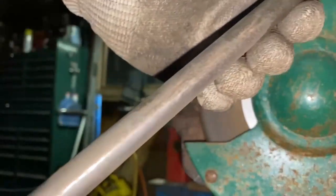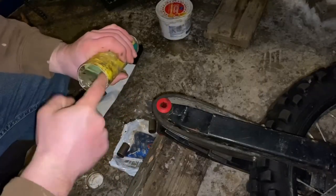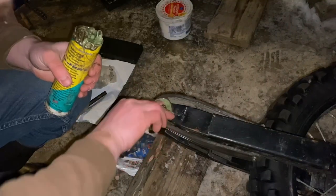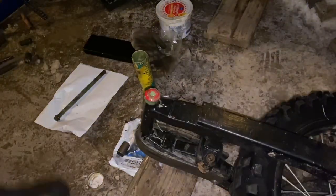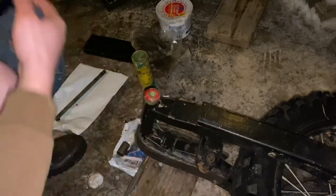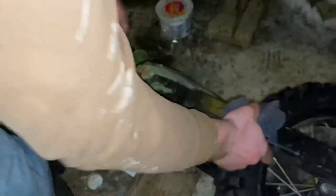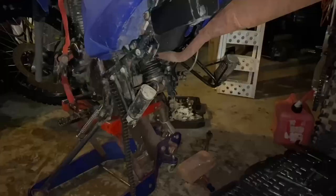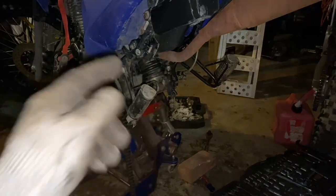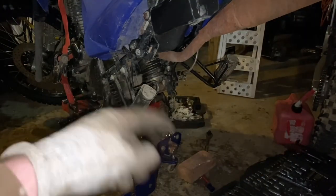So that's what a clean axle bolt looks like. The rest is pretty simple — just take and put some grease in the swing arm the best we can, then wipe the excess grease away from the bushings, leave a little bit so you can slide the swing arm back up into the frame easily. To reinstall the swing arm: put the axle bolt in, then the shock bolt, then the two 8mm bolts, the caliper line — and don't forget to throw the chain on before you put the axle bolt in.